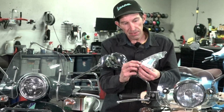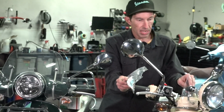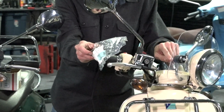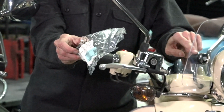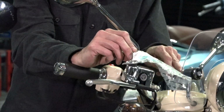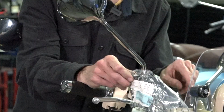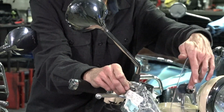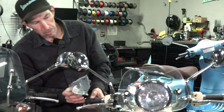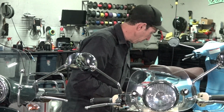One of the other items that's available is this metal bushing that's behind this plastic bushing, whether it's on the LXV or the GTV or any of the large windscreens. The plastic bushing and the rubber part aren't available as a spare, but you can get the metal bushing back here, and that's 269781. That's what the screw threads into. Screws aren't listed as a replaceable spare part, but they are a standardized metric screw.